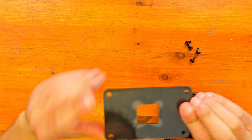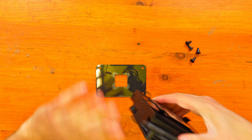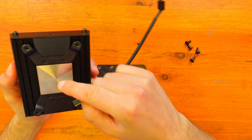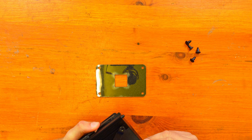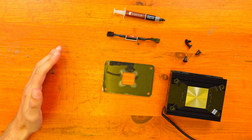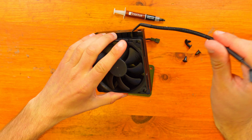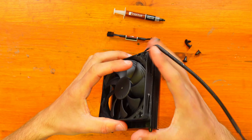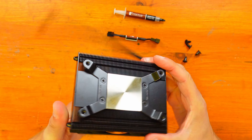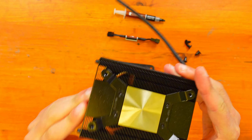So this is the back plate here — it will go beneath your motherboard and then the cooler will just sit above it. You just want to put a little bit of thermal paste on there and then screw it in from the other side. Taking a closer look at the cooler itself, we've got a four-pin PWM fan on top of the heatsink and it's a really small little heatsink — perfectly fine for our little ITX motherboard.